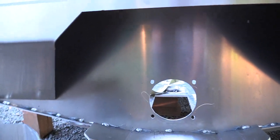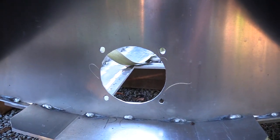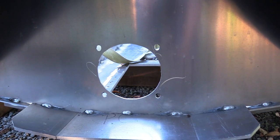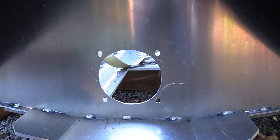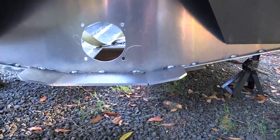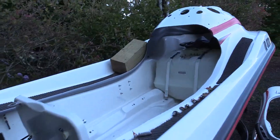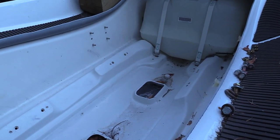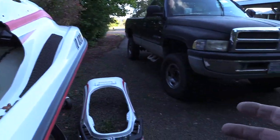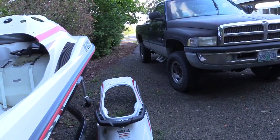So it's either outside access or a hole in the transom next to the pump — inside access. You can see the ring where the intake is going to be. I'm thinking I'll raise that back up and make the bottom of that flush with the bottom of the hole, just to get more height for mounting the motor and building a carriage for the bottom mounts. Some people just get rid of those mounts, but I don't like that idea — those bottom mounts are obviously designed to carry the weight of the motor, and the side mounts were stabilizers with softer rubber.